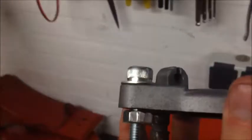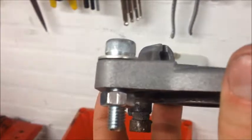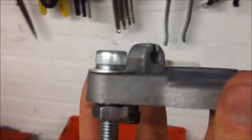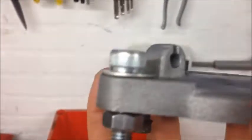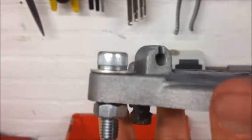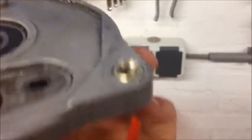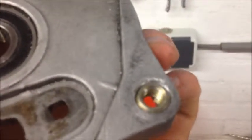The brake plate is finished. On the left side is that other solution I was talking about — basically a longer bolt with a nut on the back. Obviously you wouldn't use a bolt this long because it'll hit your wheel, but this does work. This is what people do if their M8 threads are stripped — use a longer bolt with a nut at the back to attach your rear brake plate. I like this insert solution more, on the right, which has an M8 thread inside.